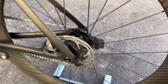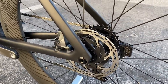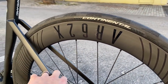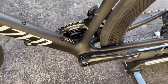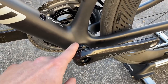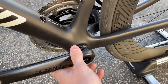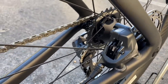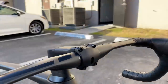Going to the rear we also have a 140mm rotor — again because we couldn't get 160s, but I think it complements the bike really nicely. It is an AR62X rear wheel, 62mm depth in the back. Going to the bottom bracket, we have a threaded BB — this is new for this year. It's a BSA 24 threaded bottom bracket, specifically a SRAM DUB bottom bracket. Stay tuned after the video for the full freehub body sound test.